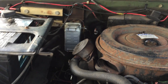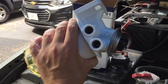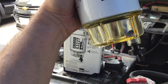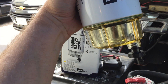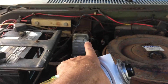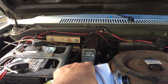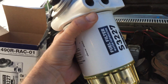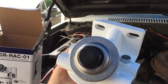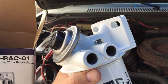All right, so here it is. This is a Racor fuel filter. I got this because yes, it has a water separator, which is a nice feature, but what I really like is the primer pump. The original had a little bleeder screw and you could, using the engine crank, prime that filter up. This one you kind of fill the filter up, screw it on, but then you get the primer — a little bleeder screw and a primer.